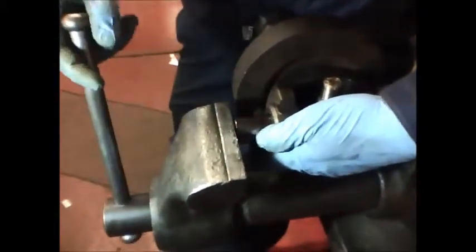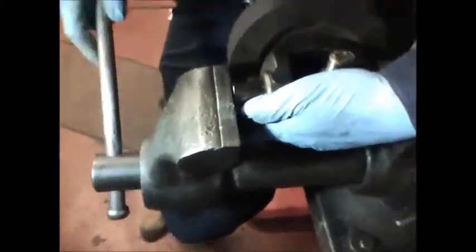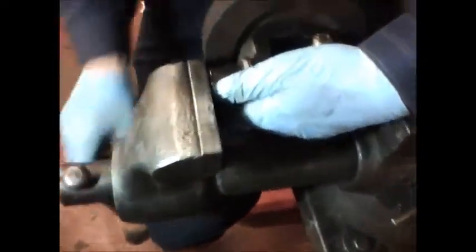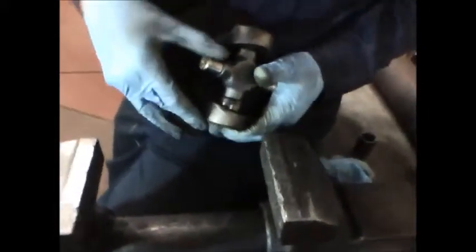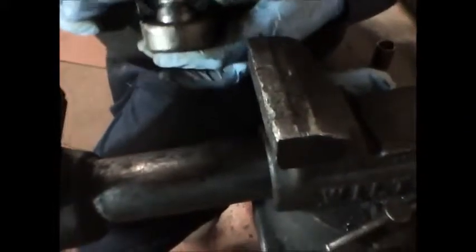So I'm going to go in a little bit further than I have to. If I want to be sure that no needles have fallen down in there, all I have to do is look at the cap and the cross. If the cross sits down tight to the base of the cap, you're okay. If you look at the cross and you push down and there's space there, well, that space is because a needle's falling down in the cap.